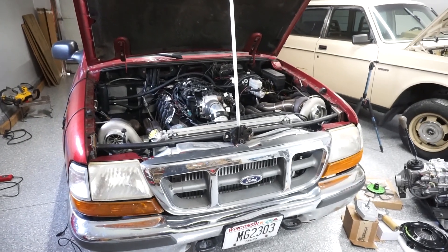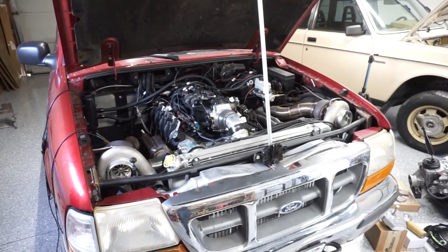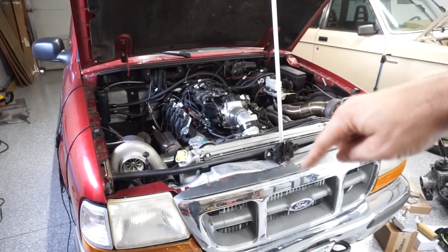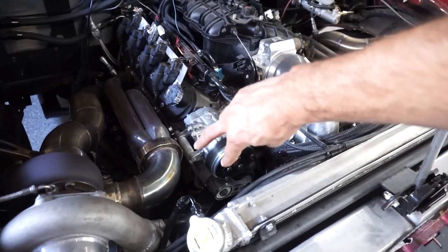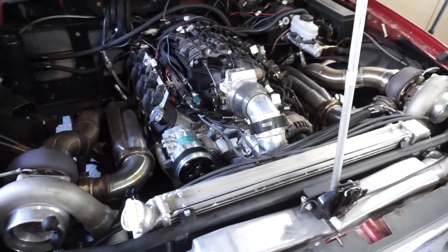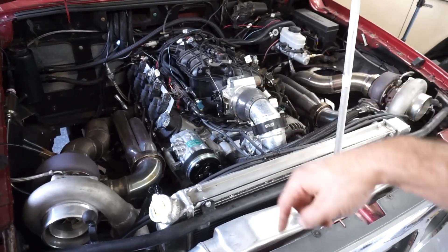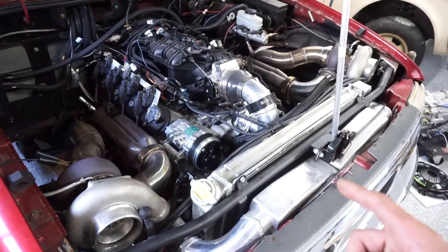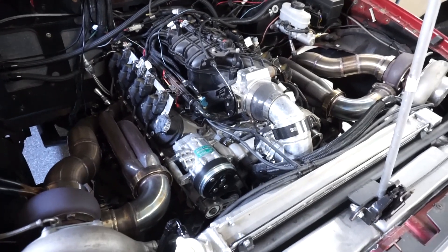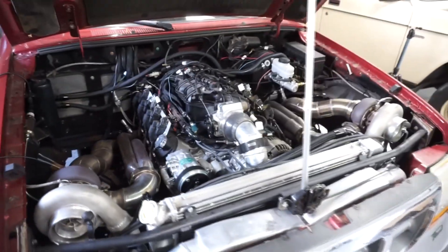It is the next day now and I'm thinking about this more. I have a theory that there's so much of a pressure difference that rises with RPM because I'm not looping the water pump - I just have the water pump blocked on both ports. The Holley mid-mount has two ports on the side and two ports on the bottom. I'm not looping them - I did drill some holes on the back side of the thermostat just so it'll circulate some fluid through there, but it's not a full loop.